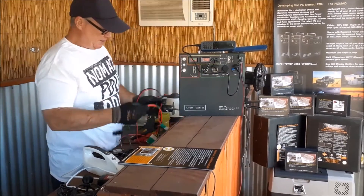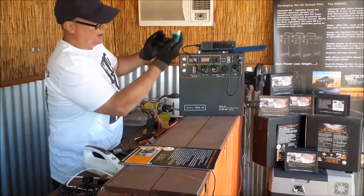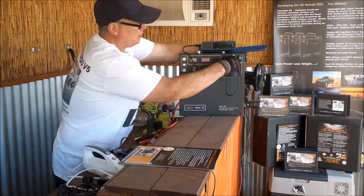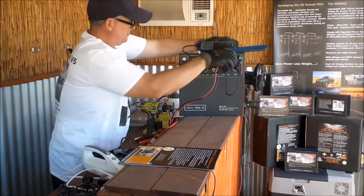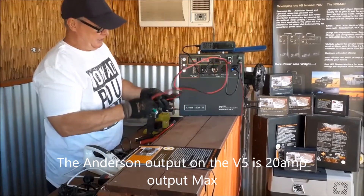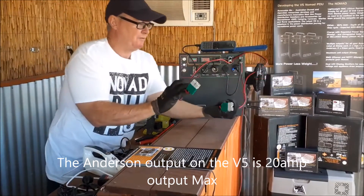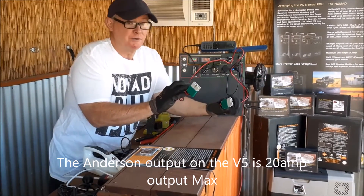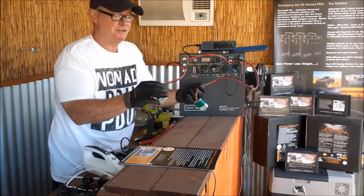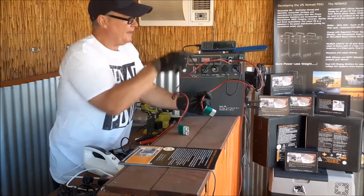The Anderson gives you 20 amps, so if you had a 20 amp output from there you could run a wire lead and quite happily run a fridge, and probably also something like a kettle or an oven. In the back of my vehicle I've got two of these units and I could run two fridges with no problems — if you had 60 or 80 litre Engel fridges you could plug them both in and they'll run no problems.